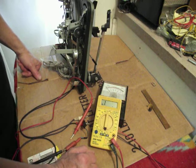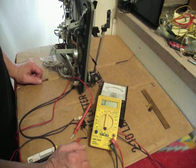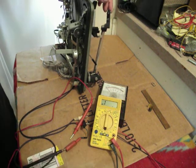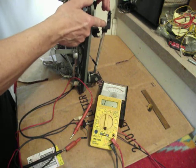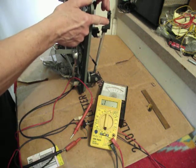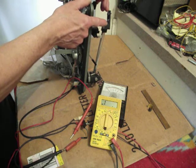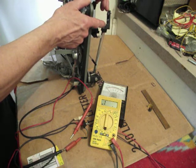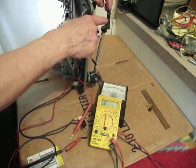I've been checking this one and did find a bad connection. I'm tracing the signal flow from the head shell. With the dual design, some models have metal contacts in the head shell that a head shell sled connects to — sometimes the spring connections are in the head shell, and sometimes they're on the sled.